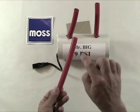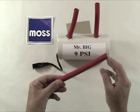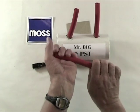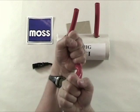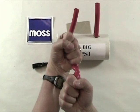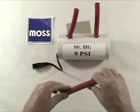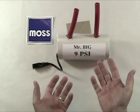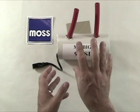Now this led to a second problem. Pressure regulators have collateral issues. The biggest collateral issue is volume loss. When the regulator is choking off the fuel to reduce the pressure down to where you want it to be, it's also choking off volume. Of course, the guy in the parts store didn't say anything about that. He probably didn't know anyway. Okay? So the new pressure regulator gets put in the car.